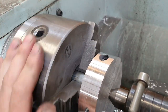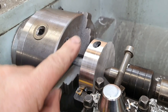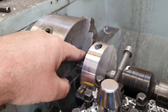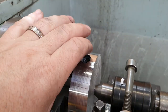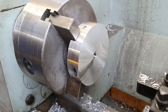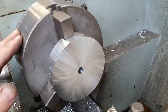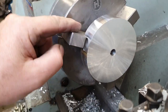It's round now — that's done. I'm going to change to the larger jaws that clamp from the outside, basically the inverse of these ones, clamp the outside diameter, face it off and bore out the center. It's too bloody nice and shiny to put underneath a car — look at that thing of beauty. You can't even tell it's two pieces.